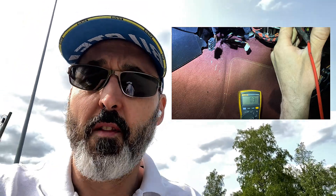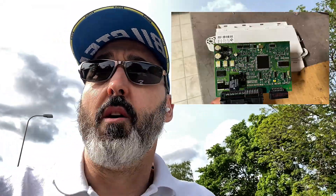However, what the guy says after that is totally wrong - that you can't measure a battery drain this way. We're not really measuring battery drain per se using an amp clamp; what we're doing is seeing exactly what is drawing current after, say, an hour when the car should not be awake. All the rear fuses showed zero. On the main fuse box there was a maxi fuse with a 0.3 millivolt voltage drop - that's the CAS power supply. The CAS was asleep, confirmed by scoping the K-CAN.